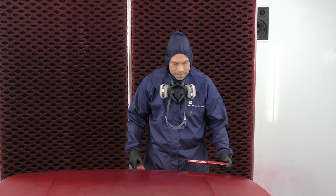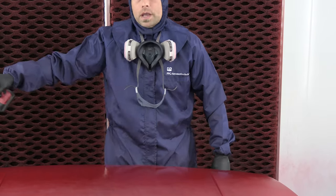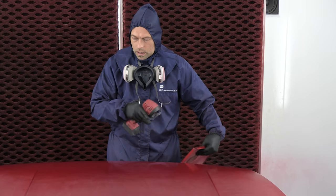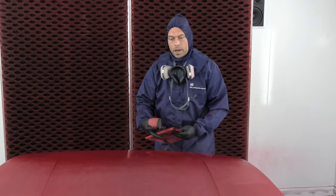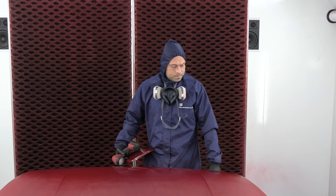We let the overspray blow out a little bit, and I'm checking my color while it's still wet to get a good idea of where it is. That looks pretty close — I'm probably going to do one more coat just on the front edge. It's just a very methodical approach — I kind of blended that out without pounding on a wet coat, because we're just trying to fool your eye into seeing an even color transition. Because it's a smaller area, it's not going to look blotchy. Also regarding airflow: the reason I'm facing the hood this way is I want my overspray to keep coming back toward the front — I don't want overspray going over the back and creating dry spray over the back edge of that hood. We don't want to create another problem trying to fix one. So just keep airflow and overspray direction in mind. We're going to let this dry, give it one more coat, get some clear on it, and we'll see you guys when it's all done.